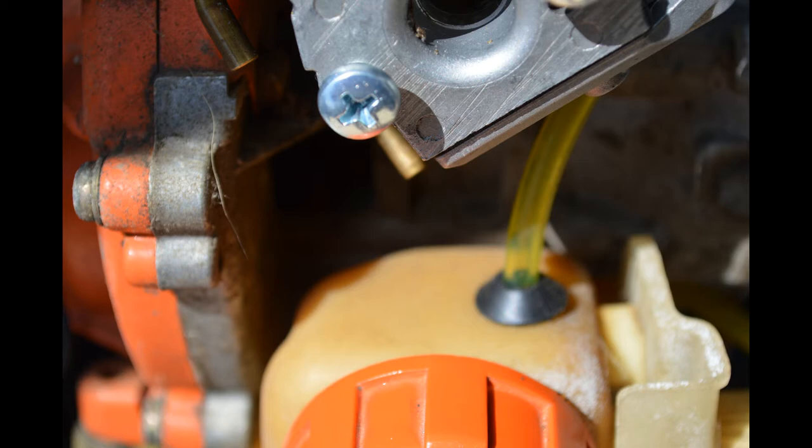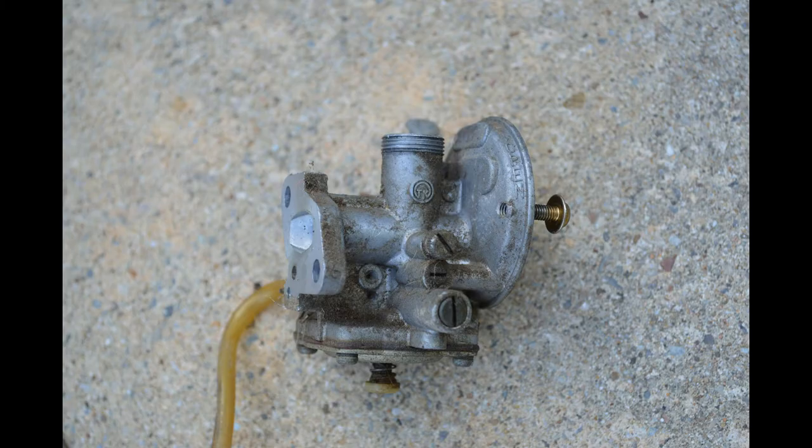The grommet part is optional. And then lastly, you'll need the screws. They're M5, 50 millimeters long, and you might need longer, depending on what type of air filter holder you use. The original carburetor, the part that holds the air filter, is built in as one piece, so replacing it, you're going to need to add something. I personally took the aluminum holder that came off of FS65s. If you use that FS65, the size screw is what I just mentioned. If you use the type like often Echo, it's thicker, so you need a slightly longer screw.